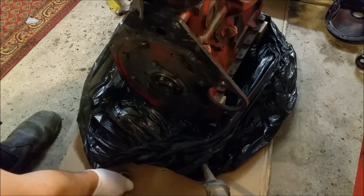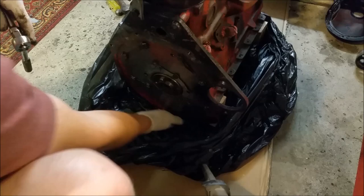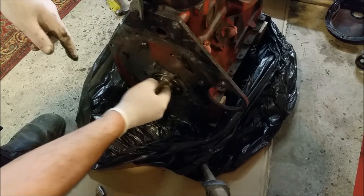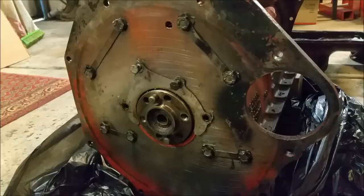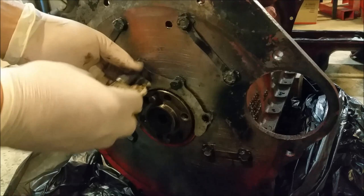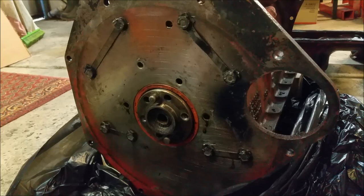When I set those blocks up, I set up enough space underneath the rear plate — there's 10mm there — so we can just slide the plate off with the engine sitting on those blocks. It also allowed about the same sort of room underneath the oil pickup as well. We need to take these bolts out now and the whole back of the engine will be revealed. This bracket is courtesy Toyota — Dave put it there to lift the engine out.